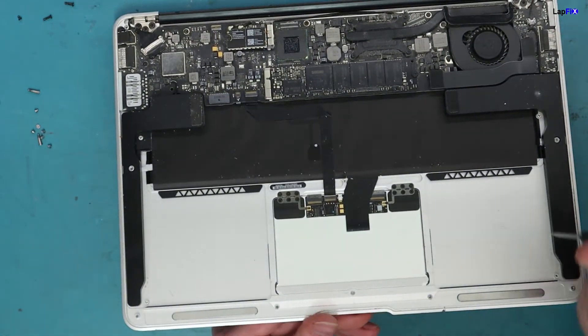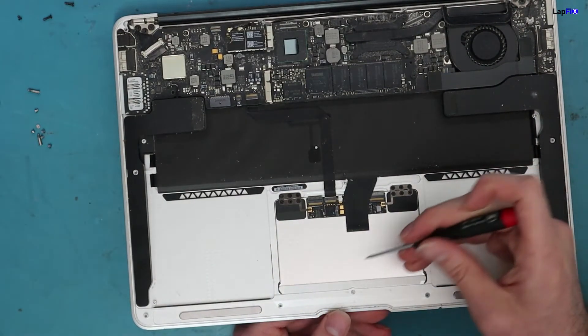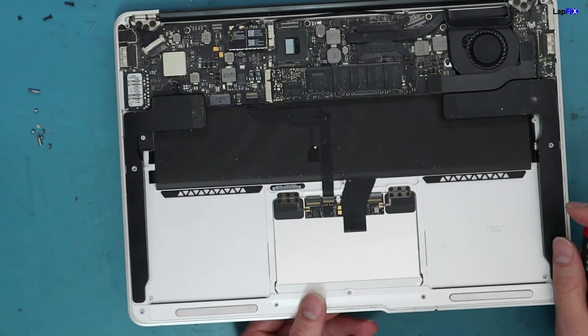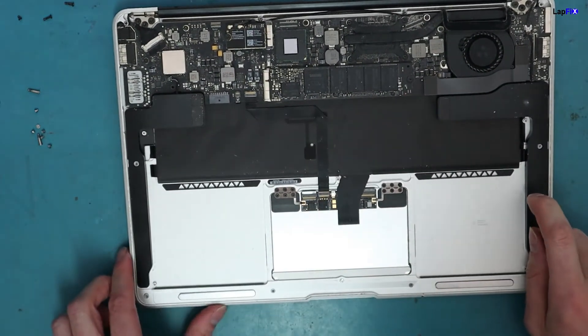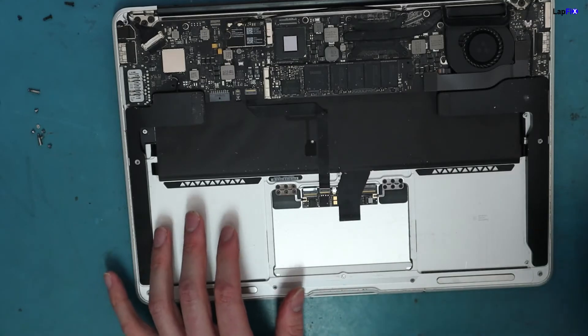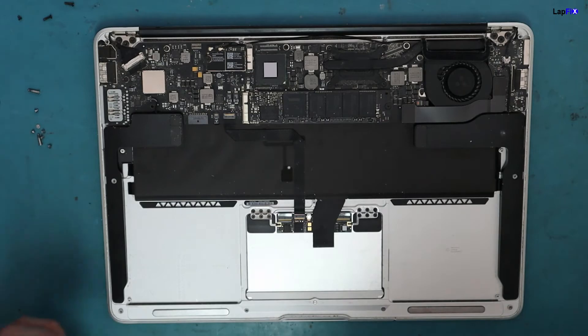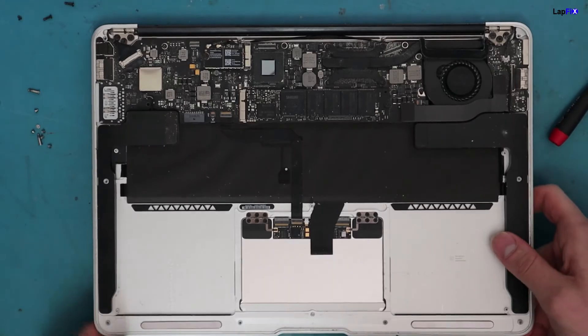That's just sometimes the screw coming loose — it can be a little bit corroded, a little dirty. That's really it just to solve it right here. If you have a problem with it not clicking at all, then you would definitely need to replace the trackpad. Most of the time when you do have to replace a trackpad, some type of component went bad. Trackpads usually aren't too expensive to replace, and repair shops can handle that easily. So that's really it for fixing the tactile bump — it's a pretty easy fix, and a lot of times these are some of the luckier ones.